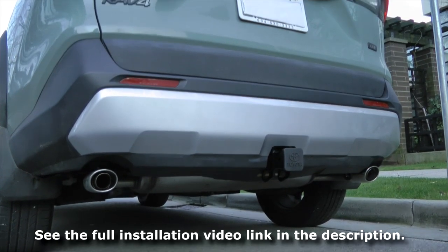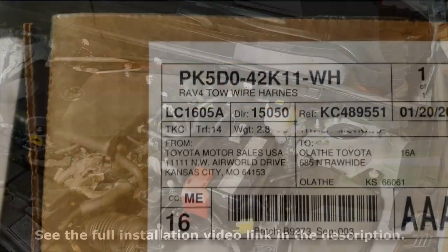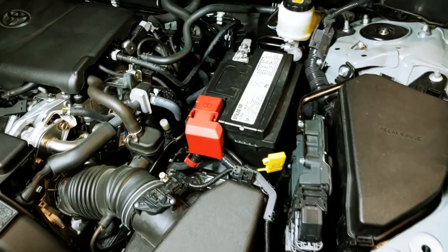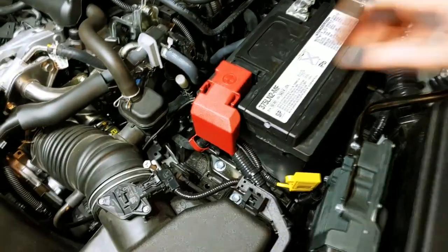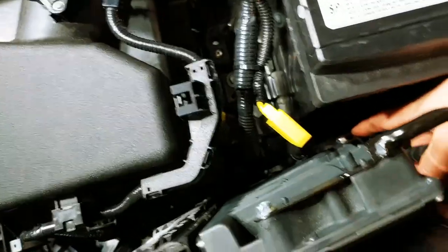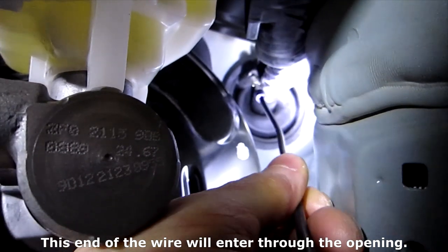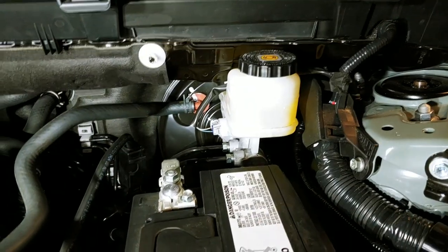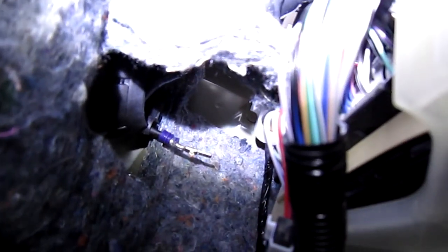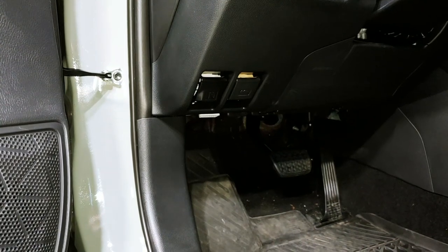Another reason why we decided to use the original Toyota hitch is because the previous one was about five centimeters lower than this one. Today we'll show you how we did the installation of the OEM Toyota hitch wiring kit. The wire will start its path from the battery right here, so the first connection will be done to this terminal. Then the wire goes below this bracket, through here, and at some point it will enter the cabin through the grommet which has a nipple you have to cut. Our power cable will exit somewhere in this area through the firewall.